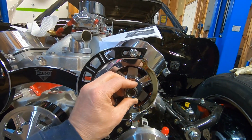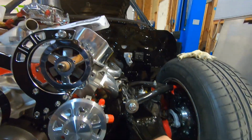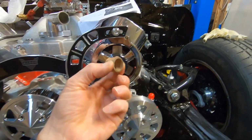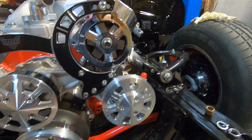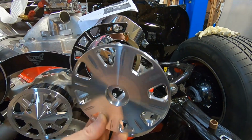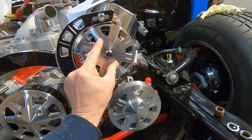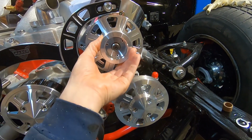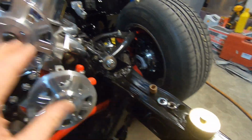All right, next we have our alternator pulley set up. We're going to take what they supplied off, nut and lock washer. There's a supplied plastic sleeve that they just put on there, keep stuff from rattling around. So first step is March supplies this really nice billet fan that's machined. It's going to slip on to the alternator first. Next is the pulley itself. And then we got to put the nut and lock washer back on there and tighten all that up.